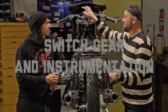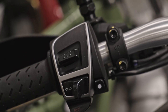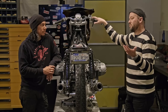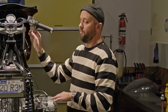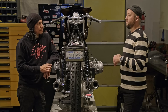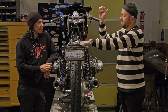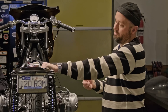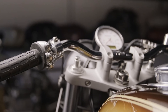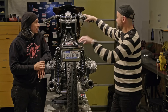Let's talk about switchgear and instrumentation. Modern switches — even today, when you buy a brand new BMW or Moto Guzzi from the factory, they're putting cheap full-load-capacity switches at your fingertips. It's cheap. Are they better than the switches from the 70s? Sure, but they're still mass produced and very inexpensive. Full-load switches require a larger chunk of wiring all the way up to the handlebars and back to all the lights — much larger, heavier wire, which is a bigger failure point. And it's plastic, which in the sun will eventually fade, become brittle, and have to be replaced. If you replace your switchgear with modern waterproof metal switches, they're going to outlast the motorcycle. They look good, they look cool, they feel cool — and if you're building something custom, those are the first things people want to replace.